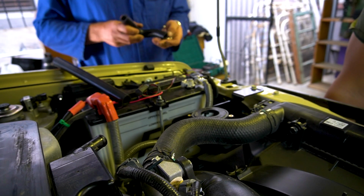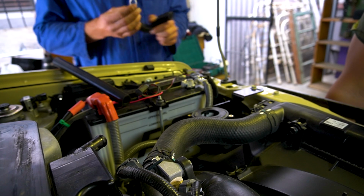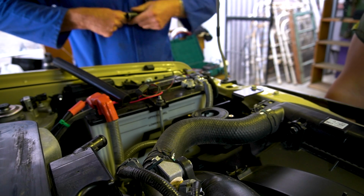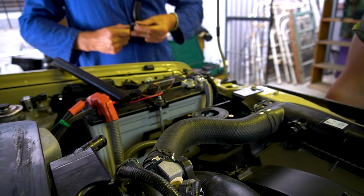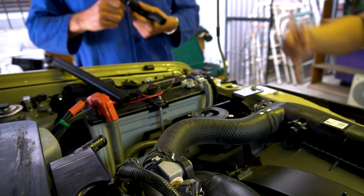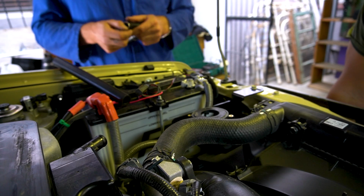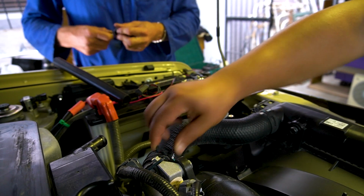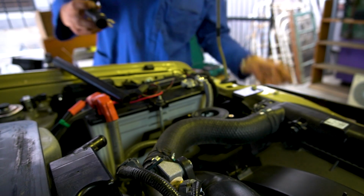So you know why they use those clips? Why? Because a hose clamp is one tightness, and then when those expand and contract, it cuts into it or not, but these can expand and contract because they pinch. All the factory stuff always has these style clamps. Lid? Yeah, the lid is.